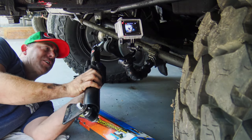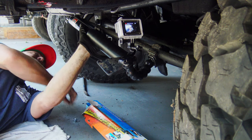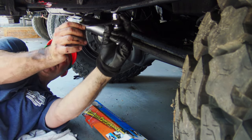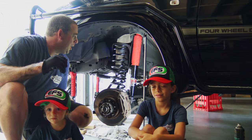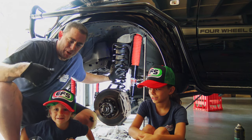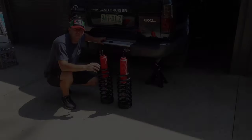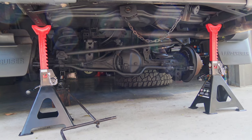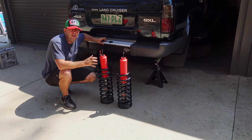I'm just putting in the steering dampener now — putting it in through there, attaching the spring washer, and putting the top bolts into the chassis. I've just done the fronts — we've got the XDR shocks on the front and the springs all in position. I've had the boys here helping me do it, they're a good team. Now we're going to start on the rear. I've got the car up on stands — the stands I'm using go to 613mm, don't go any lower or you won't be able to get the height.